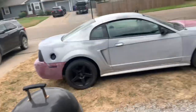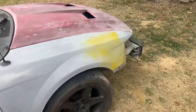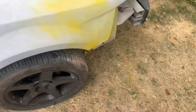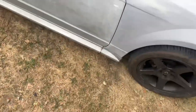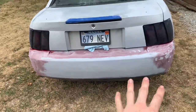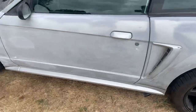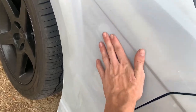It's the next day and I'm going to take a quick tour around the car. With it sanded down and primed like this, it looks like a cartoon. Up front we have yellow misted on the fender so we can sand it and check for high and low spots — we've worked this area so many times. It's still a little wavy down here. We got primer up by these holes, sanded down, and some primer on the back bumper — that still needs a tiny bit of work. The badge area is nice and smooth, and the dent up here is nice and smooth.